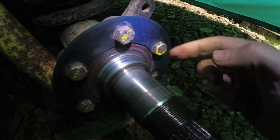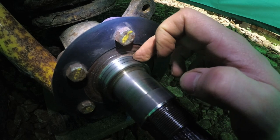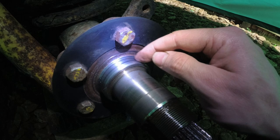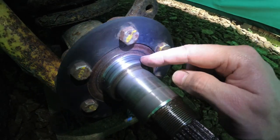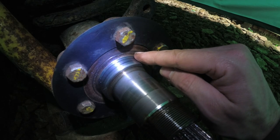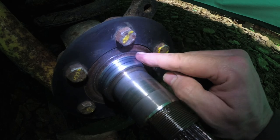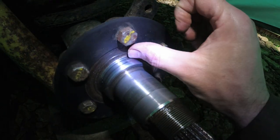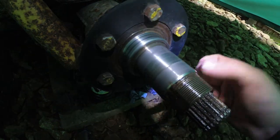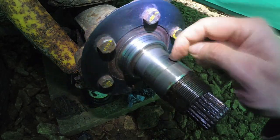On further inspection, I'm going to have to replace the stub axle. These two lines on the seal land here — not such an issue; I can't feel anything with my fingernail, there's possibly a slight indentation but nothing untoward. The two things that have led me to this decision: first, this line here is pretty rusted up — this is actually part of the seal, which I'll explain more in another video. This is a seal land that needs to run and it's not worth dealing with. It should be shiny along the back. Second reason: there was a bit of a weep along the bottom — more oil at the bottom than at the top, so there's been a bit of a leak. It's probably related to the seal, but the stub axle and seal kind of go together.